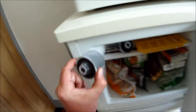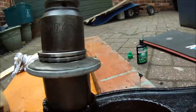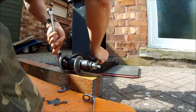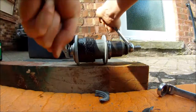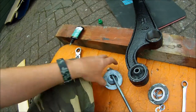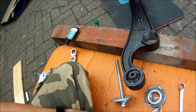The press is in place. Going back to those lines we made earlier - they need to line up with the white dots we drew on the arm. You can see it's near as damn it, because as you can see we can't see where the rubber contacts the ring anymore, so that just helps us line them up correctly. Now it's just time to get the spanner on and tighten it up. There we go - one suspension bush nicely pressed in. This lot cost all in all about five pounds. Make sure you use a high tensile bolt, not anything too cheap and nasty - easy peasy.